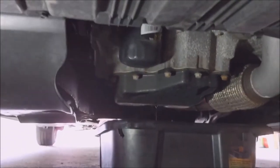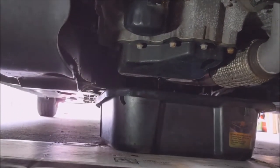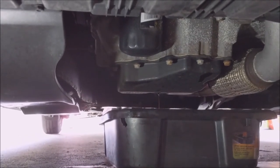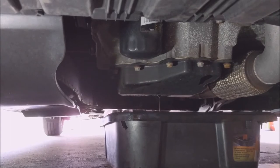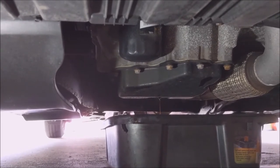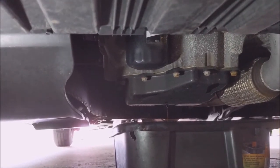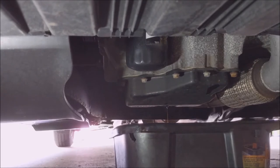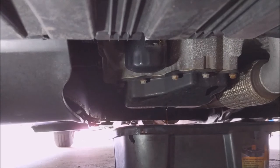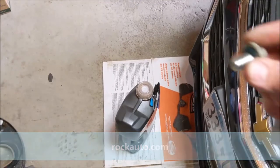The Cruze forums mentioned this filter, and it's always good to do some research on your vehicle before you start working on it. I had stopped taking this to the dealer when we ran out of our free oil changes, and believe it or not, the filter I pulled off was a PF 46. So I went ahead and got a Wix XP. I'll link to this discussion in the description — they say it's not detrimental to the engine, but from now on I'm buying the UPF 64R.